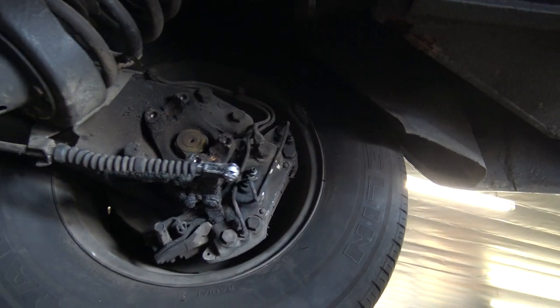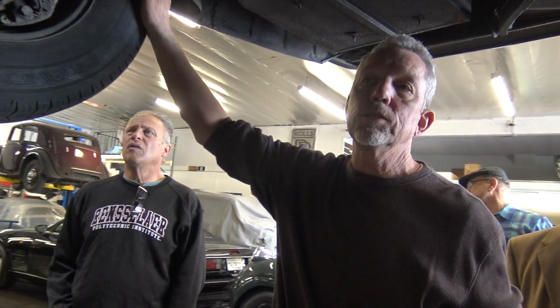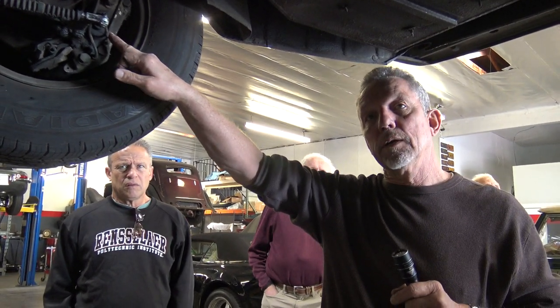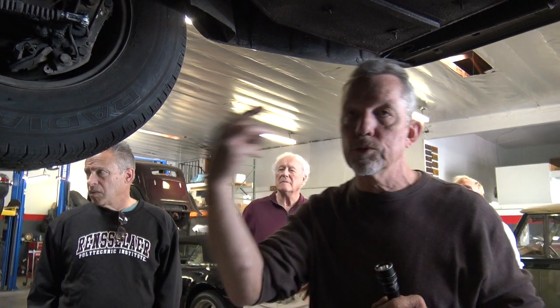The way you get a feel for the brake — in other words, the resistance you feel — will change as the pressure goes. On the later cars they have a rubber stop, so when the car has no pressure in it you can bounce that pedal and it's kind of funny, it's like a rubber ball. Earlier cars had just a static master cylinder and it's really tiny — essentially the same size as an E-type clutch master cylinder. These were five-eighths bore, the E-type is three-quarter inch bore, but that just went to the lower pistons on the rear. So that supplied the feel, the resistance, because you need the resistance to apply those distribution valves.